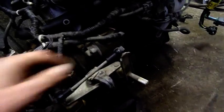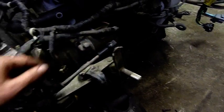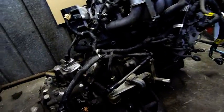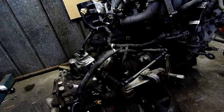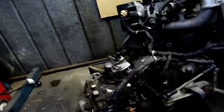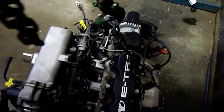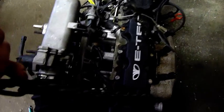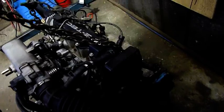I know one of my subscribers wants this linkage assembly because his has fallen apart — on an Opel car, Opel Astra or something like that. These are just a standard General Motors engine — Daewoo, Opel, all those companies use them. They're used in forklifts and all sorts of things. Very basic, crude, generic but reasonably reliable engine. This one's a 1.5 litre, I think, or 1.3 — either 1.3 or 1.5 single overhead cam, belt-driven camshaft.